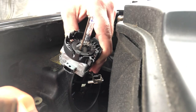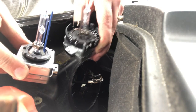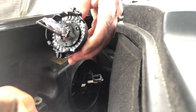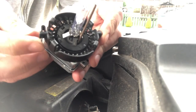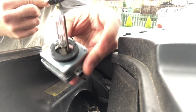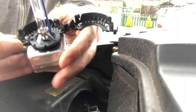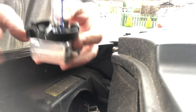At this point you may wonder if the ones you bought don't look like that - but fear not. This is the new one and this big black retaining sleeve will come off. There's a little clip here - if you push that through it's just a retaining sleeve that helps mount it. Put the old one out of the way, then drop the new one back in place. There's only one way it'll go - it'll locate once you've got it right. Clip it back in and reinsert.